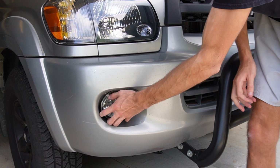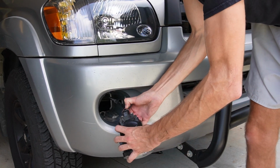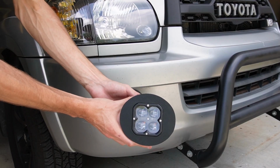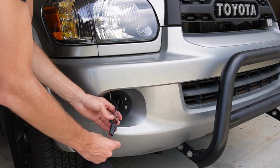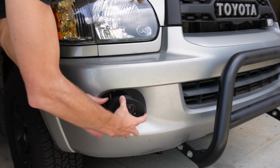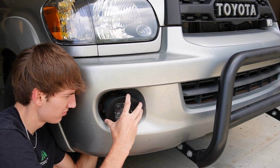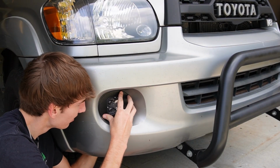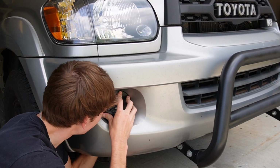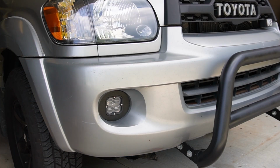Moving to the other side, I went ahead and got the light loose, again by removing the 3 screws on the bottom of the mud flap, pulling it back, and then wiggling the light loose. So that just comes right out, and then we grab our new one and plug it right in. Red on the left, it should just snap right in. And then from there we can guide it into the bumper, put the wires back there. Now I found something helpful to do is to put one hand up under the bumper through the mud flap hole and kind of help guide it in there. That way it sits in the bumper correctly. And that made it a lot easier in the long run.